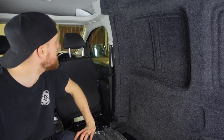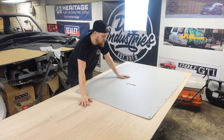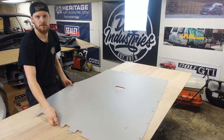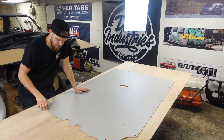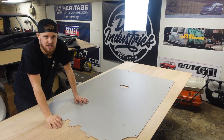Now it's time to tackle the headliner. I've marked on it what I've got to do — took it to the bench, put it on top of the ply, drew around it, jigsaw that out, carpet it and get that up, and that bit's done. Then it's the flooring and we're not far off. I bought a sheet of three-mil hardwood plywood for the new roof panel. The reason I can't use the original cardboard panel is these castellations on the top front edge go into the headliner, and the cut-outs are for where the bulkhead goes. Since we've not got the rest of the bulkhead in anymore, that'd be a bad detail on the roof. We need to remake it to get rid of these castellations, and also extend the furthest front points by about 10mm to go nicely into the crease in the front roof panel.